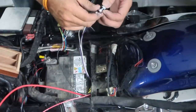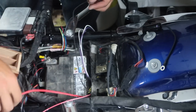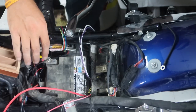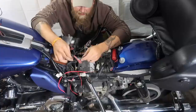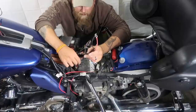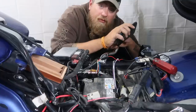Now you're actually able to add that ground. We can go directly to the battery with these, so we'll have to get our battery disconnected. I have this all disconnected. Essentially what we're going to be getting rid of is this fuse block for the heated gear and this one for my powered phone mount. We're just going to cut those off and wire them into the PDM.